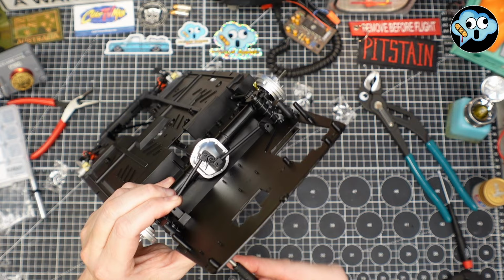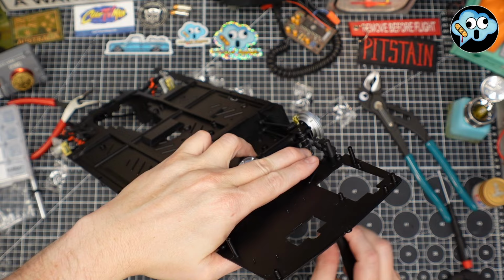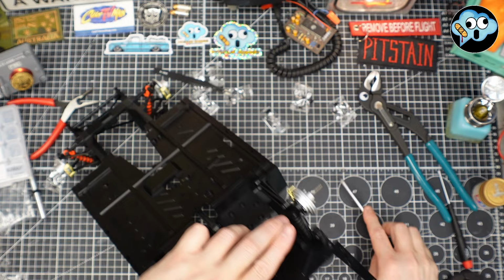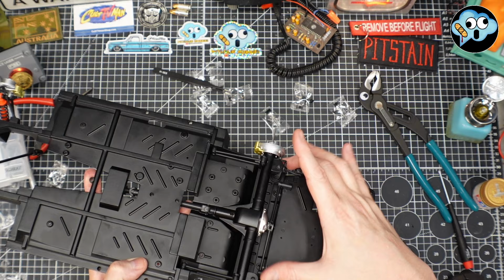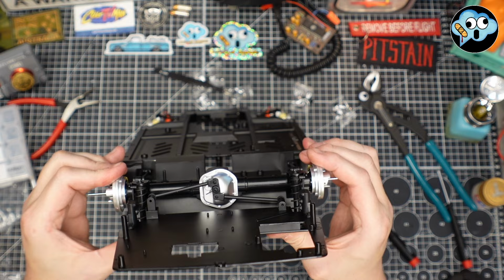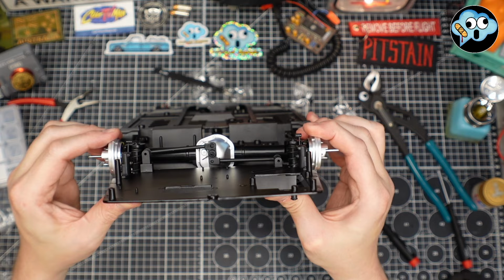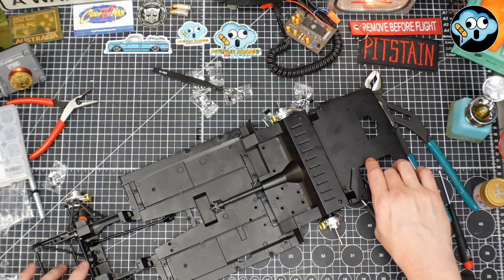Oh, this is so amazingly beautiful. Aston Martin, you bloody geniuses. This is such a lovely suspension. And these weird little, some sort of gas or hydraulic dampers act as an anti-roll bar and act independently. Because with a solid rear axle, you want as much independent wheel travel as you can get. And then that Watts linkage works, and I'm telling you, it works just like real life. That's exactly how they operate in real life. That is so freaking cool. I don't even want to show it this way. I want to keep it this way so I can see the cool Watts linkage setup in the back.